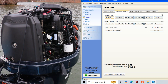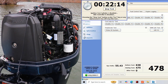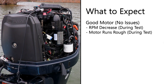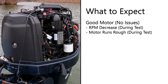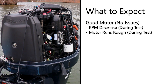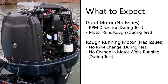We'll now proceed with our ignition test and disable cylinder number one. When we activated the ignition test for cylinder number one, you should have noticed a drop in engine RPM and a change in the sound and the running quality of the motor. This is completely normal and to be expected on a properly functioning ignition system for cylinder number one, since with this test we basically removed our ignition from cylinder number one, causing the motor to run rough. If we noticed no change in engine run quality, that would indicate we have a potential ignition issue with cylinder number one, and further troubleshooting of the ignition system for cylinder number one will be needed.